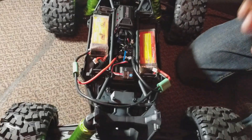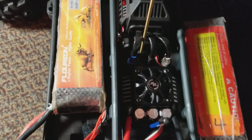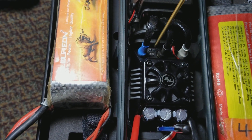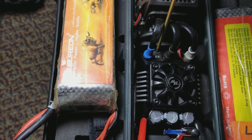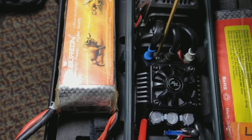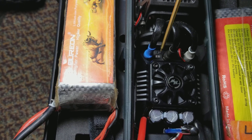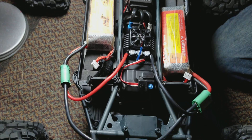Now let me state this as a fact: this LED right here is going to flash red one time when you press and hold the set button. Power on the ESC, hold the set button until this LED flashes red one time.